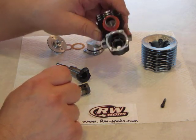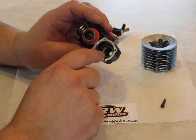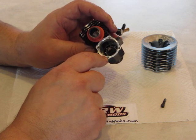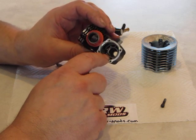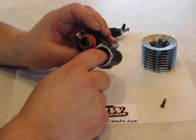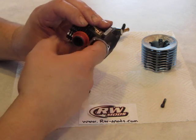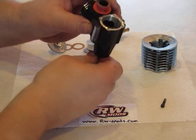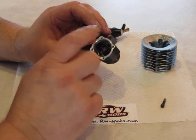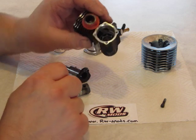Another thing to look for is the rear bearing — I've already installed the front bearing. You want to use the right special tools any time you change bearings; it helps the bearing last so much longer. Once the block is cleaned up, the oils from the nitro fuels — castor oil and thicker oils — can make the bearing feel pretty good. But once it's cleaned with WD-40 it may feel loose. I'll stick the crank in and rock it back and forth to check. It took me rebuilding quite a few motors before I could tell if a bearing was bad. When in doubt, just replace it — they're not too expensive and it'll save you parts down the road.